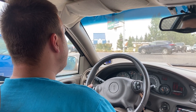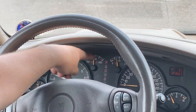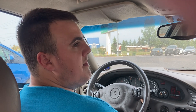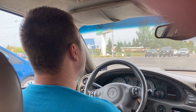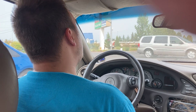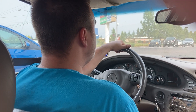It's like a sauna in here - we closed the windows for the video. The only problem I'm having is seeing three warning lights: traction control, anti-lock, and the brake light, which means ABS. It did this before and I bought a new ABS module, so I'll try that and see if it fixes it. If not, it could be the body control module.